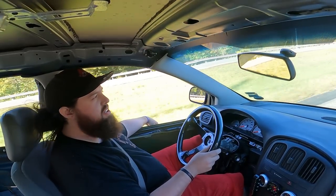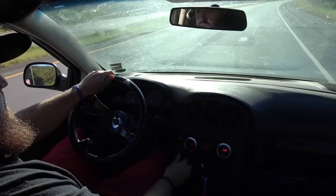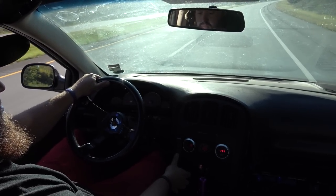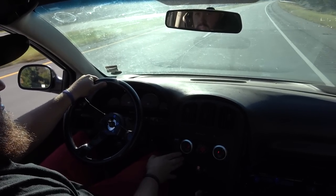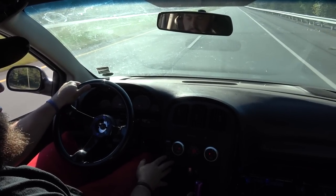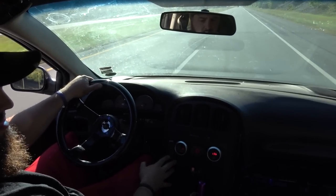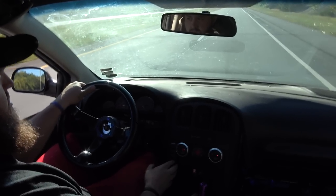This thing really sounds like a tractor now. So we just got back to the shop — it did all right. I noticed it made a lot more boost just rolling into it than it should have, so I must have something wired backwards. I went into the boost box and zeroed everything out so it should have just been on gate, but it definitely looked like it made more than 10 pounds of boost, so we're going to check that out.